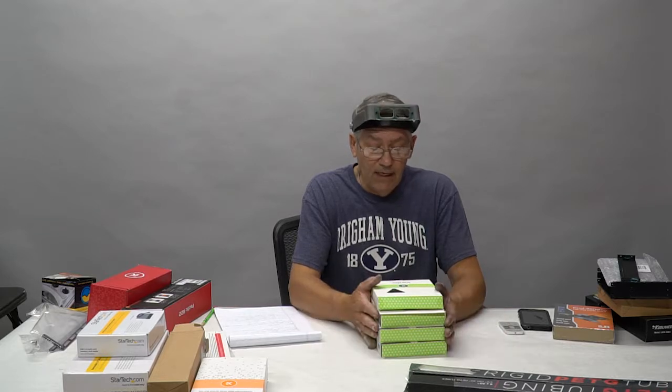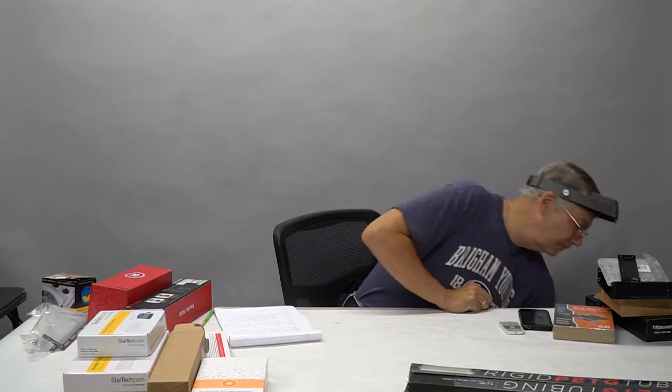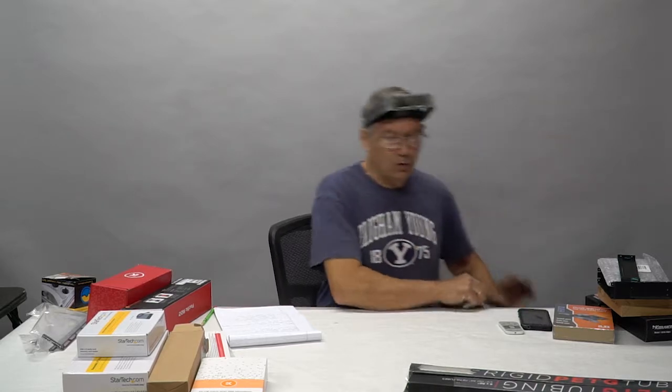Now this radiator is designed to operate perfectly with 800 RPM fans. So why would I have 1850? I'm running 1850 fans so that I can knock these down to about 50%. So these things are going to run, you're not going to hear these at all. And in the event you want to really hammer this system and kick the heat up, we can run these fans up to 1850 and increase our cooling on the radiator just a little bit. I like having cooling headroom.